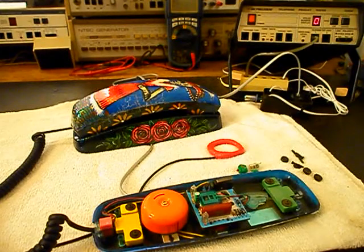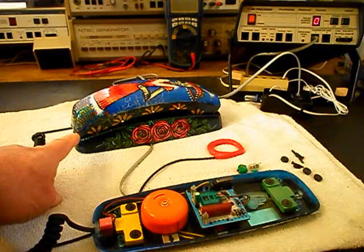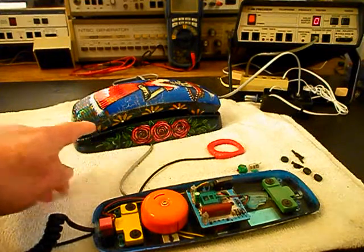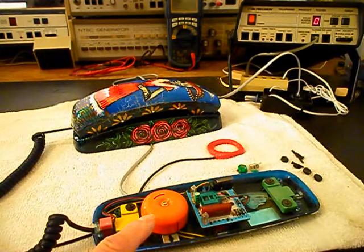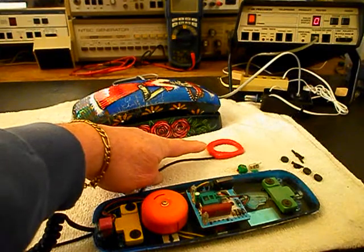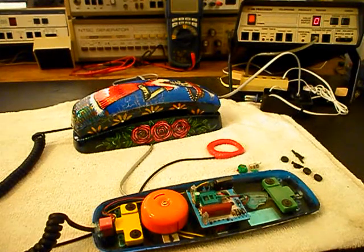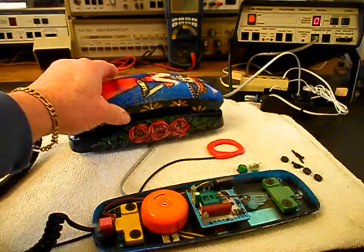We're back now, and we're going to show a little bit about what's going on. We went ahead and replaced the modular port at the handset, so that's been taken care of. We located another issue, and we had to take the base cover off because we want to show you something. I have a pickup here which is amplified — that's for the audio of the handset so you can hear it. I want to turn the amplifier on and go ahead and place it on the pickup.